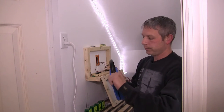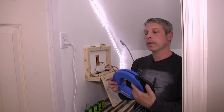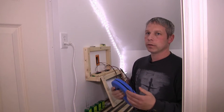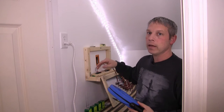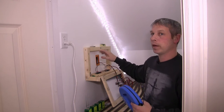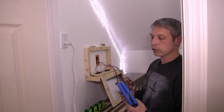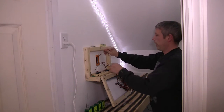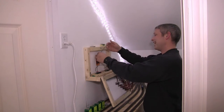This is my snake — I got this at Home Depot. What you do is you just pull the wire out and stick it up through the hole. If you've got a wall with no insulation it's going to go fairly easy, but if there's insulation or any obstructions in the bay it's going to slow you down. Fortunately when I laid out the panel I picked a bay with no obstructions — no wire runs, no piping, and no insulation. And of course the one time it goes right through the hole unexpectedly is on camera.